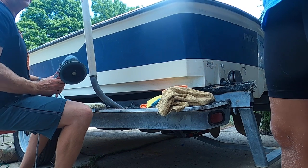All right, so whether you're buffing with compound and a wool pad, or you're polishing with a foam pad, the process is basically the same. You're taking your polisher with your tool on there. You're getting your compound onto the surface of the boat. You'll start at a low variable speed to make sure that you're getting the compound worked into all of the gel coat. And then you'll take it up a few notches, take it up a few notches, and finish with a real high vibration to get it really buffed out.